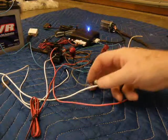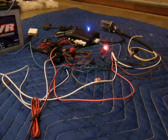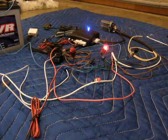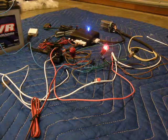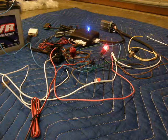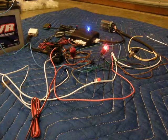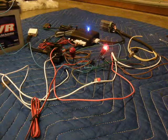To set the ignition latch we just pull the clutch lever and you can see the ignition comes on. The red LED flashing indicates the number of remotes that are programmed into the system — it's flashing twice which indicates two remotes. That will normally go off after the first 90 seconds of operation. Now that the ignition is on, of course the bike can be started.